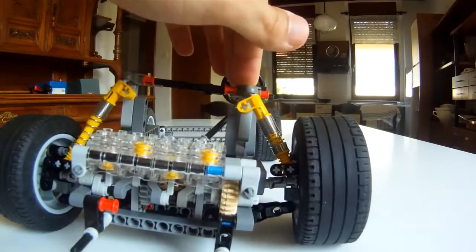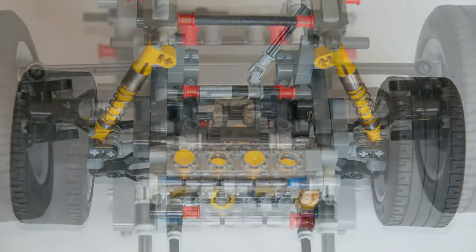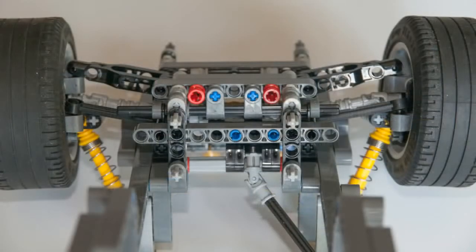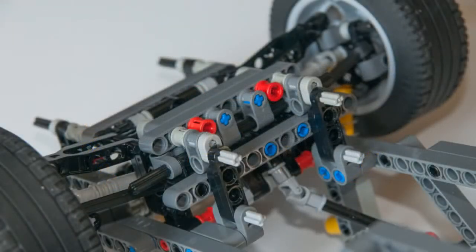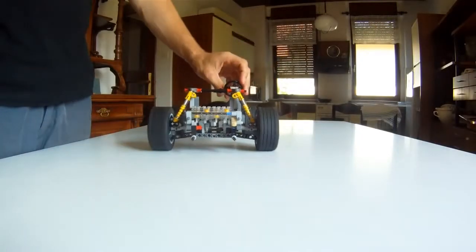When building a chassis, the other benefit is also that the lower wishbone is not pushed downwards because of the force of a spring that is attached to it, which allows us to make the suspension bridge smaller and lighter. And as I mentioned before, because there is no upper wishbone and the springs, or struts as they are called here, take over the role of the wishbone, it leaves more room between the wheels for engines and other stuff.